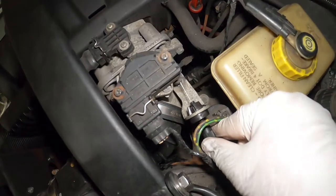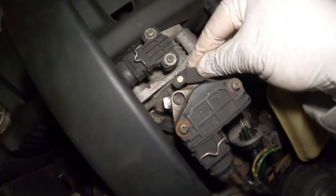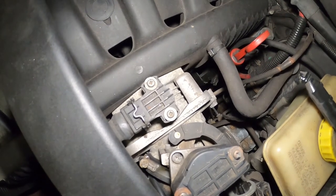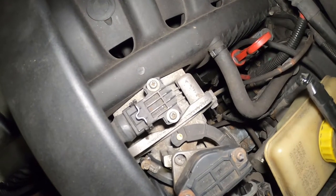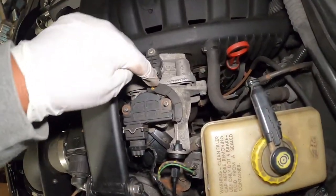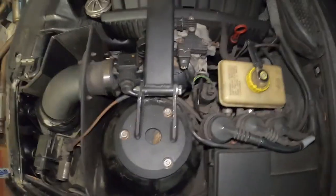You have to adjust so the tension is good enough - not pulling but resting properly. When this pull lever is all the way back, the throttle valve is closed; by default it has to be open so air can get into the engine. I turn this wheel a little bit to see if it's moving toward the open position. It stopped moving and now if I pull it moves gently - I think this is good tension.